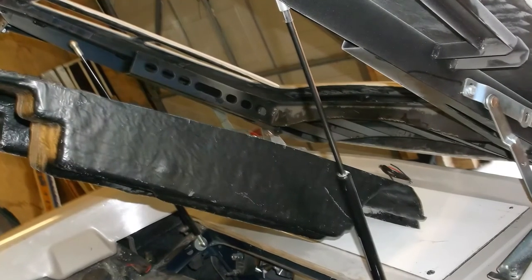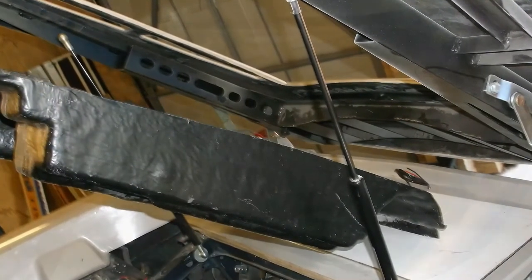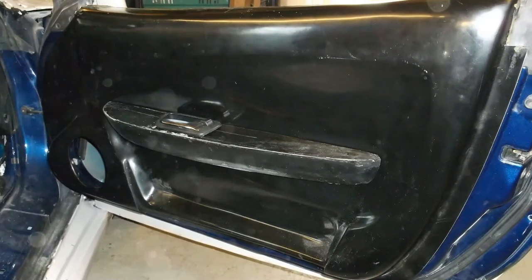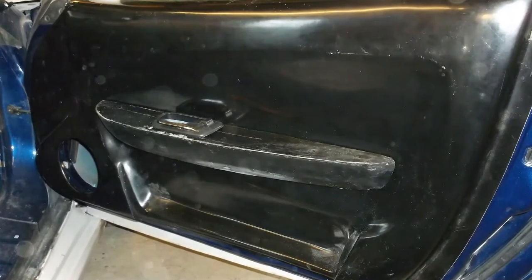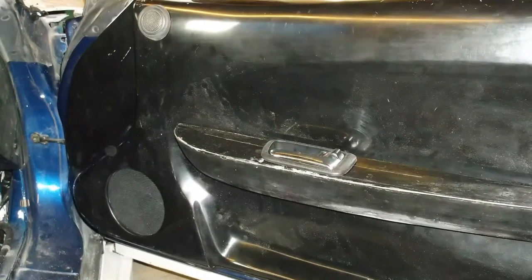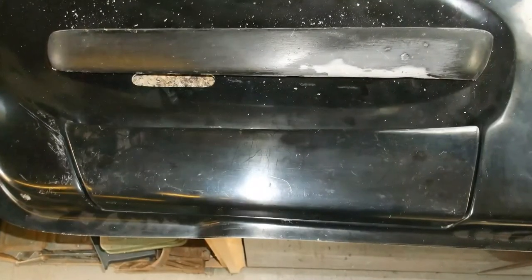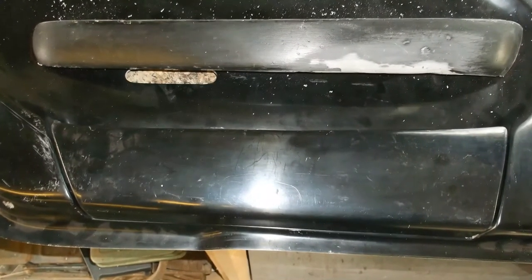Using a couple of straps, I can connect the front of the fake engine to the bottom of the rear deck, so when you lift that open it'll lift up the fake engine as well. Before sending the car away to be painted, I test fitted the supplied door cards. These need the armrest fitted, and you need to cut out and install the original MR2 door handle so you can open and close from inside. I've also cut out and installed the main speaker and tweeter into the door cards for a decent sound system, and the door pocket is installed on the lower parts.